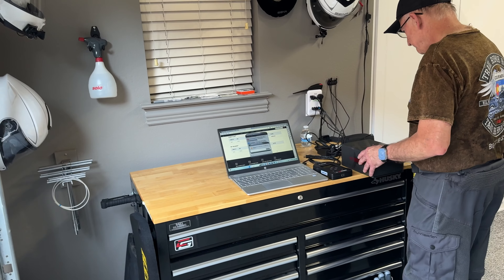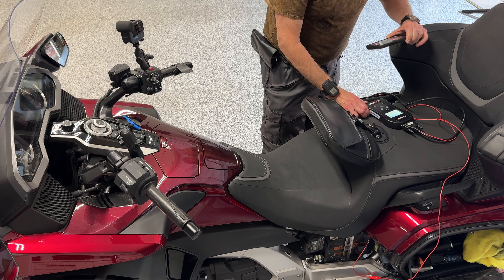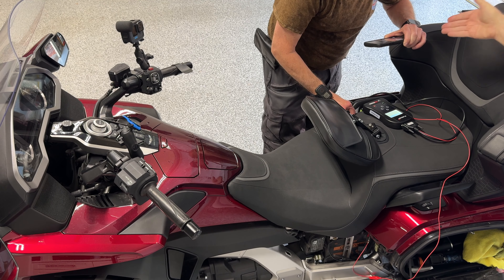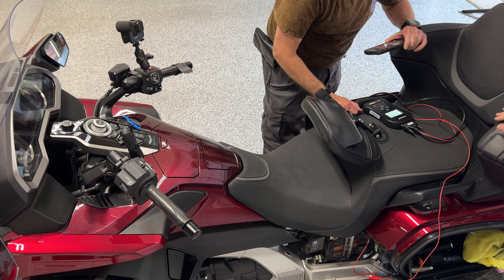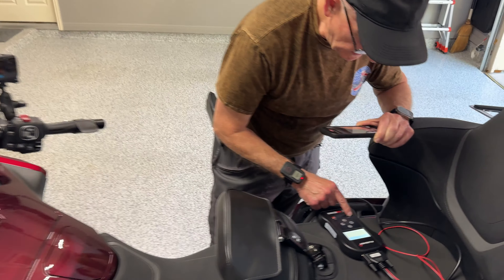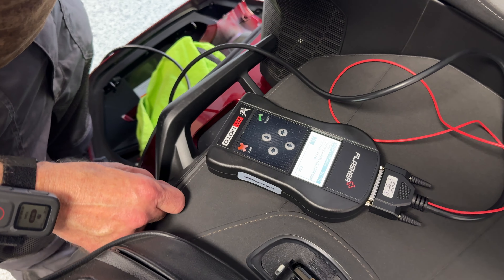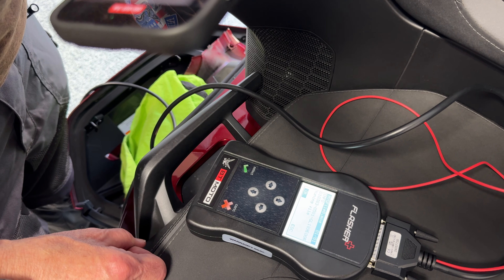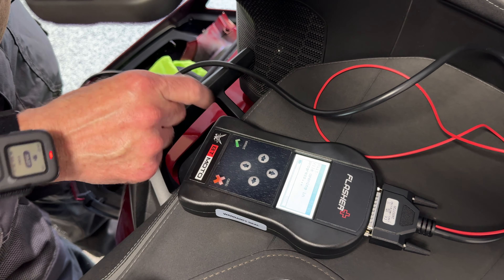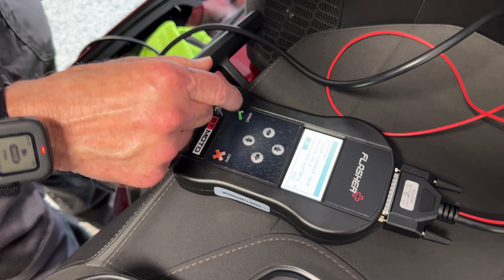I think we got his new map installed on the little handheld unit. In the main menu, the first thing we do is hit work, select OK. Then it asks for protocol and says writing — we select writing. There it shows the name of the tuning file — that's the one we just copied over to this flasher, so that's really encouraging. Operation in progress. Please connect your vehicle to a stabilized battery. Switch on the dashboard, check the connections, and press OK.